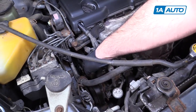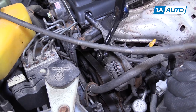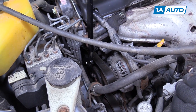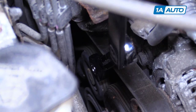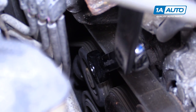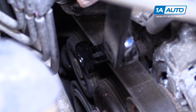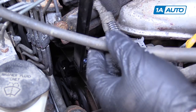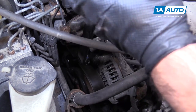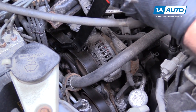You need to remove the belt from the pulley. I'm going to use a serpentine belt tool to loosen the tensioner. It's not spring-loaded — it's got a shock on it. There's a 19-millimeter welded on, or it's a nut part, a hex drive that's part of the tensioner. When you pull down on this, you basically just have to slowly compress it.